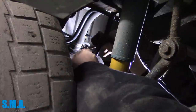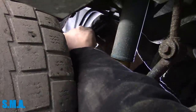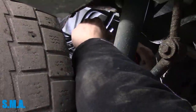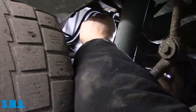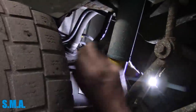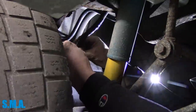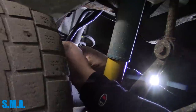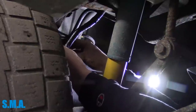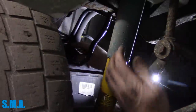What I was hoping to teach y'all was how to logically find the broken wire. If we didn't have it glaring us right in the face with its green pus, then what do we do? We want to break the system in half again from where we were. The easiest way is to find another connector. However, if there isn't another connector, you find the easiest section of harness to get into, open it up, and poke the wire. If you don't have what you're missing there, you move further towards the last place where you had what you were looking for.